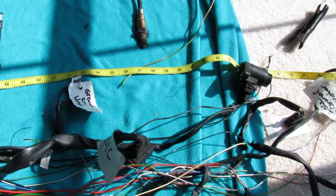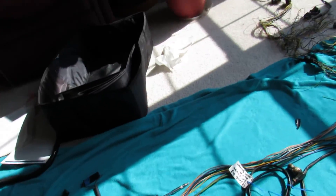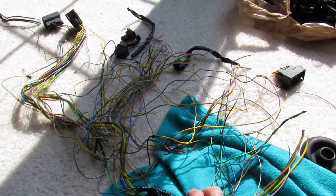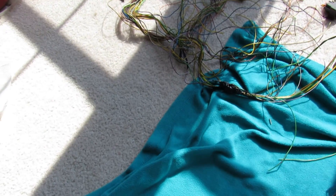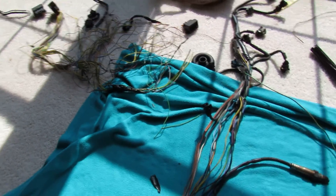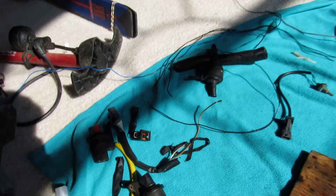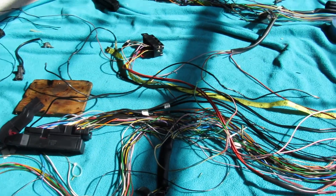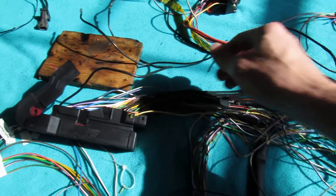From 53 to 73 inches, about there. What I've done is gotten another harness out of a car where the engine was pulled out and the harness was cut right near the bulkhead, but it gave me the perfect amount of extra wire I need to extend the harness with the same color wires. I have the ground wire here, and I'll show you how I'm splicing these together. I've already spliced one ground wire.